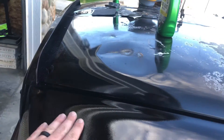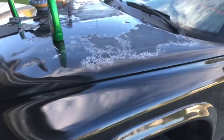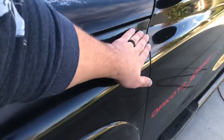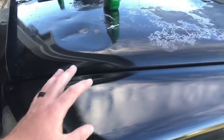This side's dry. I had to wet sand it but there are a couple spots that are kind of popping up. It just looks so much better than it did — this is the after. I still need to wet sand it and put a polish wheel to it with some compound to try to get it a little smoother. I'm going to go ahead and do that now while that side dries and I'll show you the process.